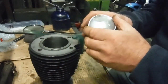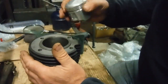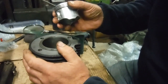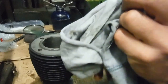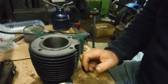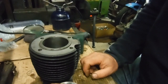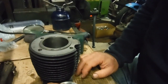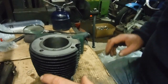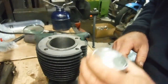Just a little splash of oil, a rich needle position, and treat the engine with a bit of respect initially. With some engines I've suspected of being rather tight, I've given them uphill work on a quiet stretch of road. You can sometimes feel just a slight moment — perhaps a split second — of power loss, and if you can get the clutch in and throttle off, chances are the engine doesn't stop and you can coast to a halt with it still ticking over, pause a couple of seconds, then get going gently again. Repeating that process can be a fast way of running an engine in, although get it wrong and it can be a fast way of ruining it.